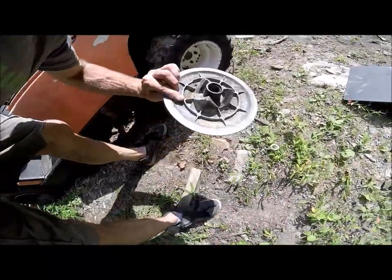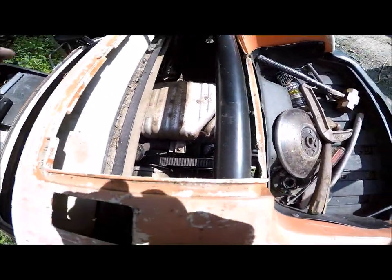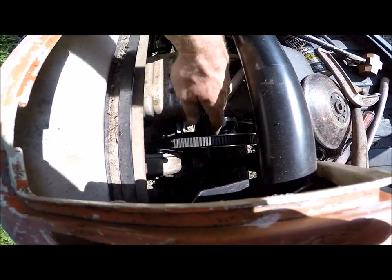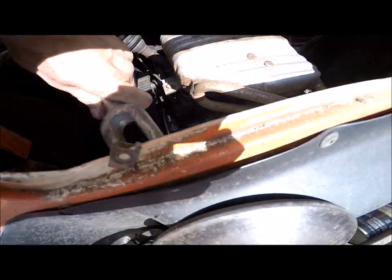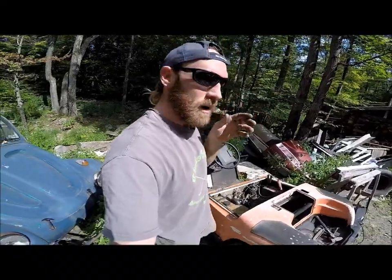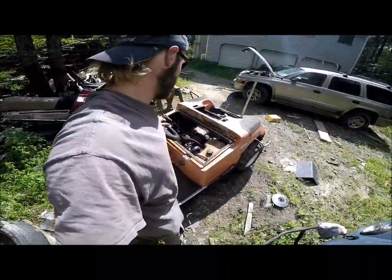Hopefully that was a little bit of help for you. Those clutches were shot — you can see it tore the whole inside apart. This simple little upgrade was very tricky to actually get together. What I ended up doing was putting it all together, putting one side on, then using a big steel bar to wedge down and hold that sheave over so I could slide the clutch all the way over. Then I used a ball joint splitter wedged in to keep that first sheave from sliding back, then I was able to put the belt and the other sheave on. I pressed it all over with the big bar, got the nut started, re-squared everything, and tightened it all up.